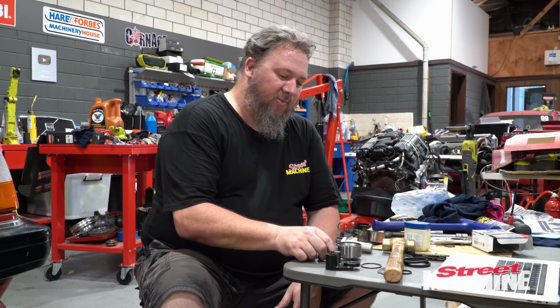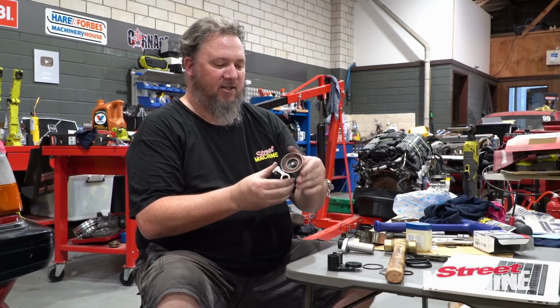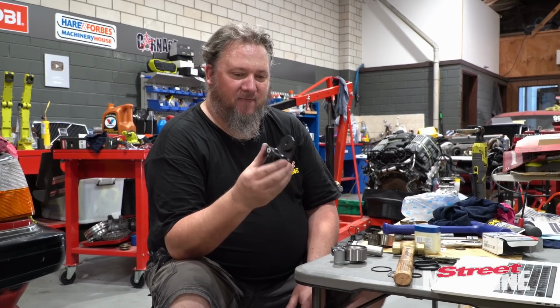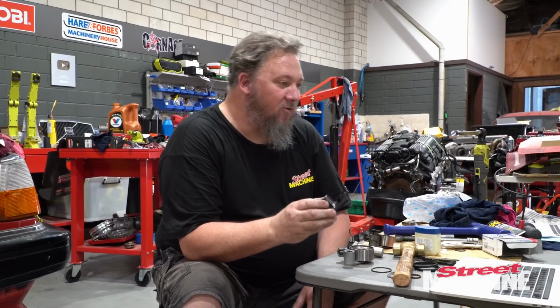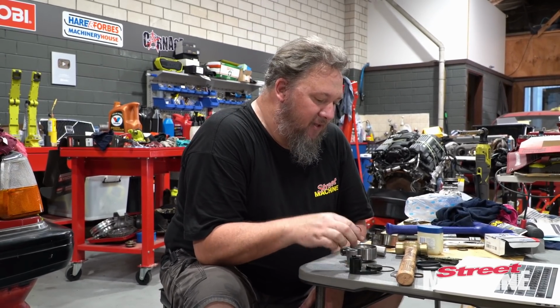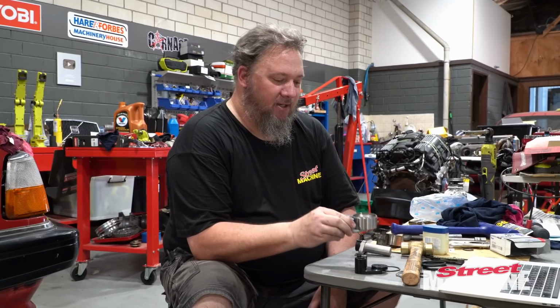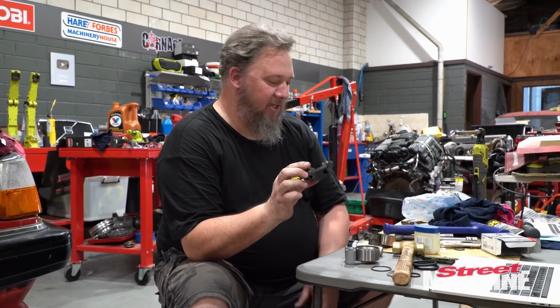So now it's time for our timing belt tensioner, and we have one there brand new out of the packet with a factory style cast housing. And then we found this in our box of bits as well. So Golby sent us pretty much everything we need, and we're looking at that going, so why do we need that if it's already on that? So I looked up Ross Performance Parts, who make this part, and according to their website, these units have a tendency to snap. Well, that's not good. They're saying if you up the horsepower at all, these things can snap, so use their part instead. Of course use their part, but anyway.